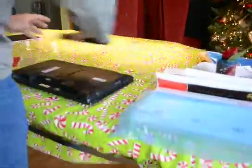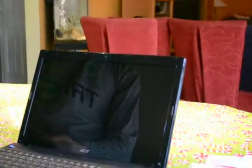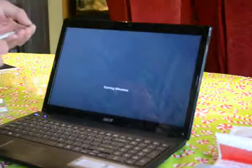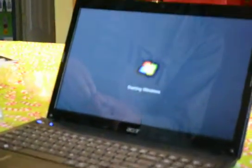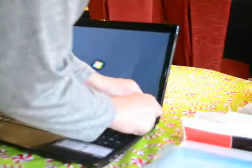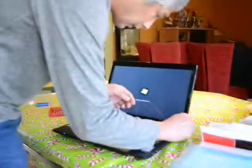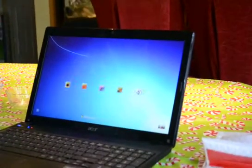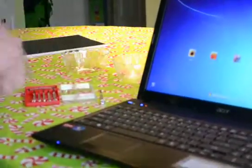Let's put the battery in first, then put the screws in and power this up so you can see it is working again. Put in the bottom screws — these were originally shipped with what looks like a mild thread locker applied. I don't think that's necessary to reuse, but if you want things pristine you can use thread locker from any hardware store. Then put the screw covers back on — note that they've lost a lot of their glue, so you may want to either discard them permanently or get them replaced by the manufacturer.